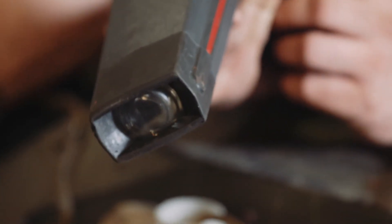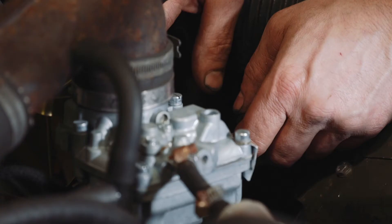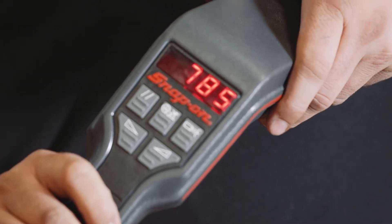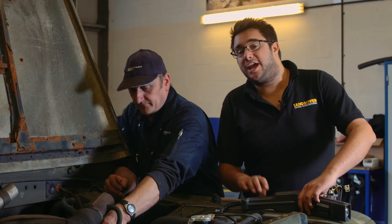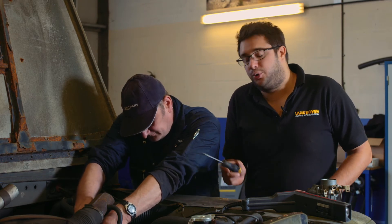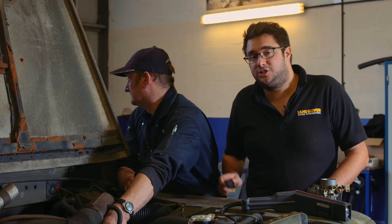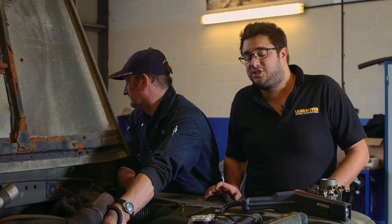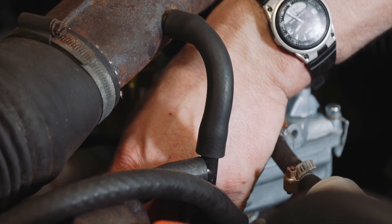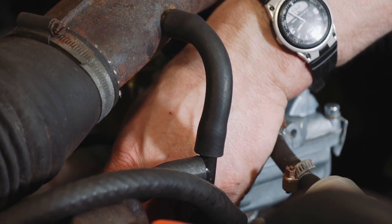We're almost there now — we're about 730, so a little tweak more on the idle speed screw. We've now set our idle speed; the timing light is reading between 750 and 800. The next stage is to adjust the idle mixture, done with a screw just inboard of the carburettor. Steve's tweaking that now. For the MOT, the CO mixture from the exhaust must be below 3%. At the moment we're just above 3%, so Steve's going to lean the mixture out slightly at idle.